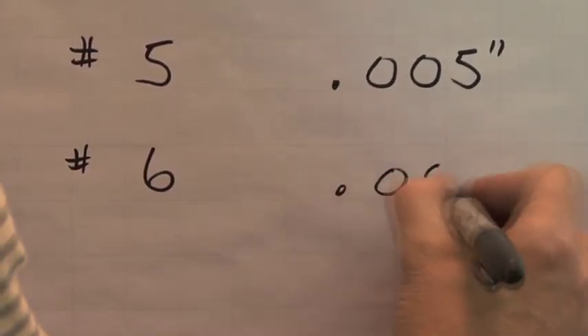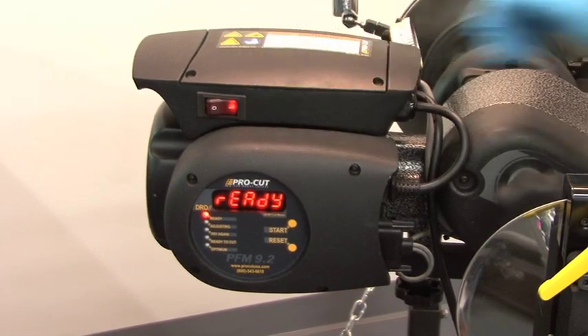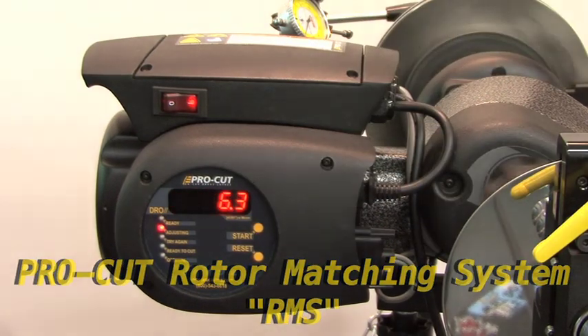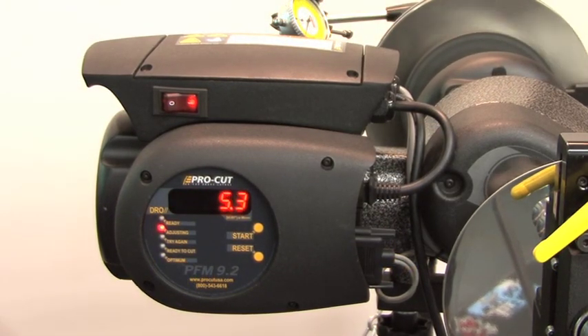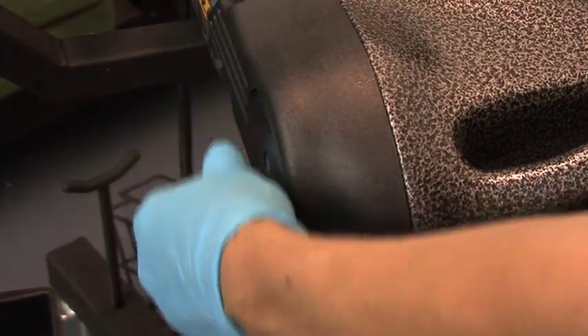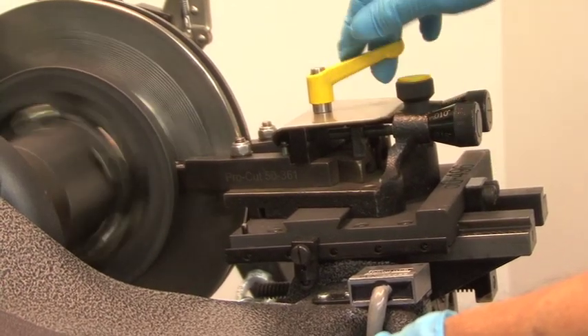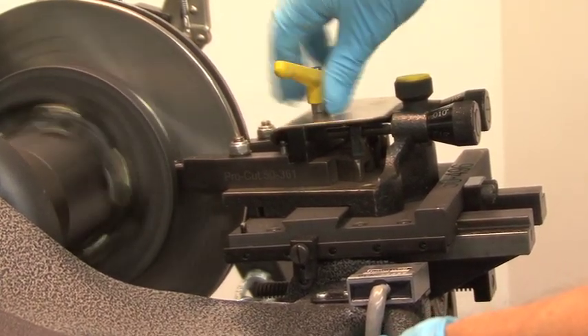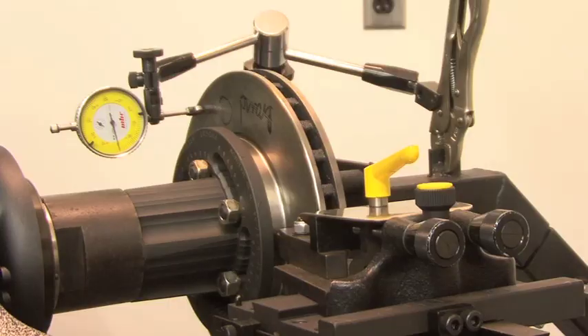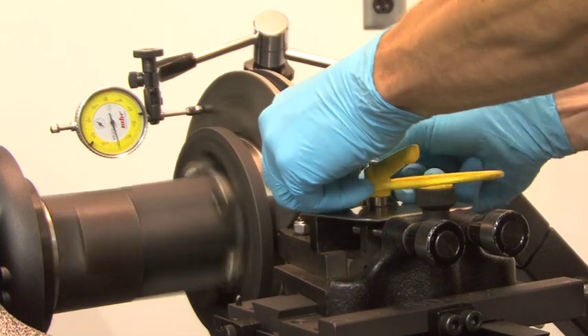The important question is, how are we going to correct it quickly and efficiently? The answer given by most OEMs is with a ProCut PFM rotor matching system. With the touch of one button, the machine adjusts relative to the vehicle's hub so it is in near-perfect alignment before making the cut, so this rotor will match this hub perfectly. In this fast-motion demonstration, we show how to correct lateral run-out using a ProCut PFM 9.2. The entire process will be completed in 7 to 9 minutes.